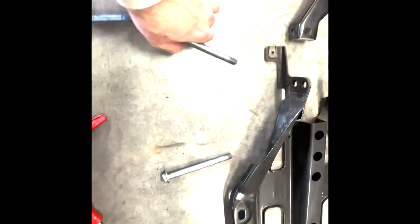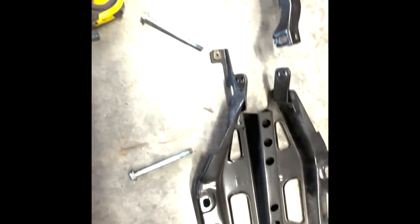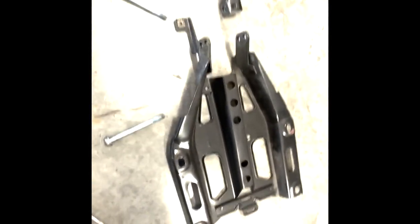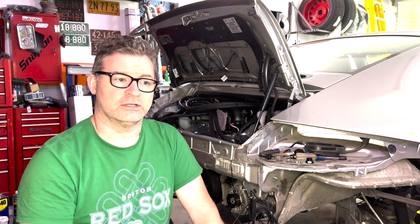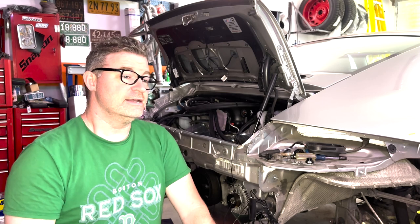So the cross brace isn't there anymore. There's a little lock tab that I didn't feel like cutting off until I knew for sure what I'm doing. Holding it with both hands, the gap is just shy of an inch and a half, so that actually might work. First note: you cannot flip the bracket. The way the bracket is designed it will hit the transmission, so you cannot get it perfectly vertical at all. You have to prefabricate the bracket, and if you're going to do all that you might as well just cut the ears off and do the welding like everybody else has done.